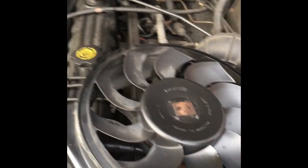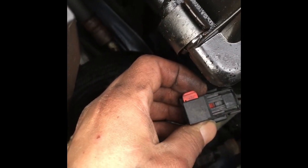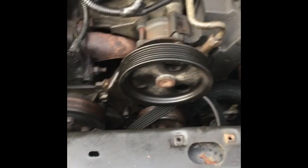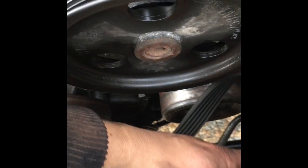To start out, you have to remove your fan. If you look, there's a tab on either side that'll have a screw in it — this one's pretty well busted up. There's a connector here which leads down here in front of the air box; there's a red tab on it. You push the red tab over into that position, then push down on the back and the connector slides apart. You also have to remove your serpentine belt — this is a 15 mil. After loosening this bolt down here, you loosen the 15 mil, and it'll move this pulley down and away so you can get the belt off of the pump.